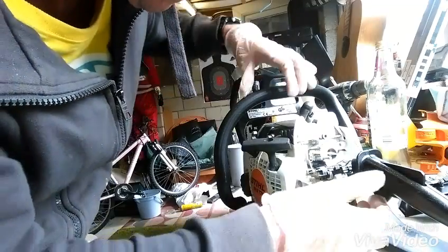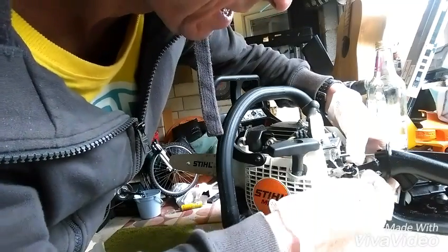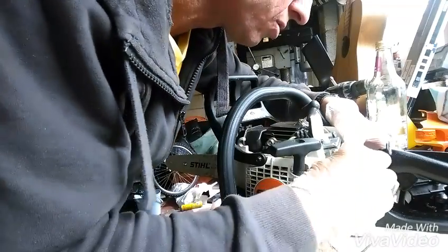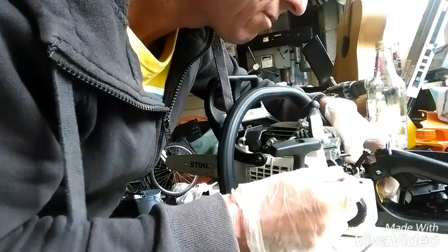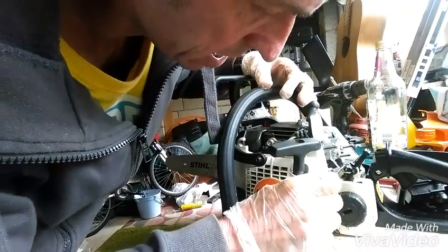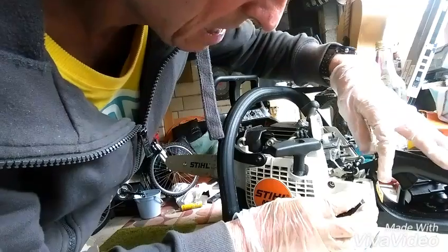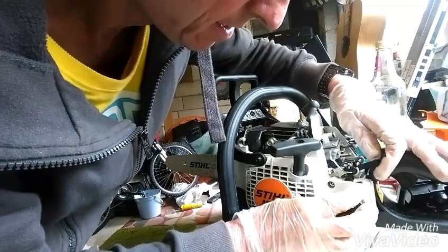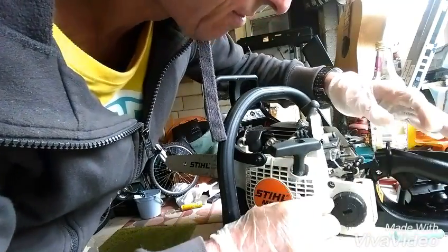So once it goes back into the up position, this will be position one. When it goes into position zero, this metal here will come over here and touch this, which then shuts the circuit out, which stops the saw. Because before this was always flicking out and apparently it was never shutting down properly - hard to shut down without choking it. So that was why - because that was in the wrong position. Also this was bent in like a real tight U position, so once it was here it was really difficult to get from there to there. So we've opened this up a little bit there now.